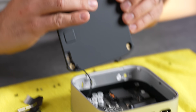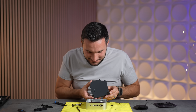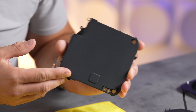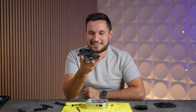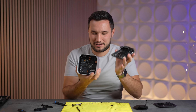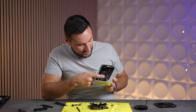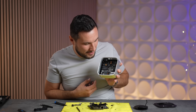Wait — is the whole power supply going through this cable? No way. That's how you know the M4 chip is efficient and low-power. This is literally how everything gets powered through this tiny connector. The previous Mac Mini was 170 watts — way overkill for Apple Silicon, because they had six-core Intel models with tons of wattage. But now look what they need: super thin, doesn't get that hot, airflow just goes around it. Incredible — all built in.